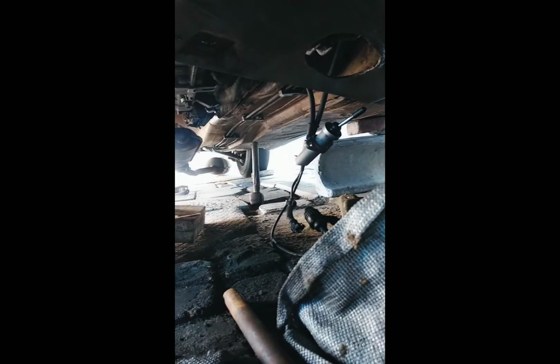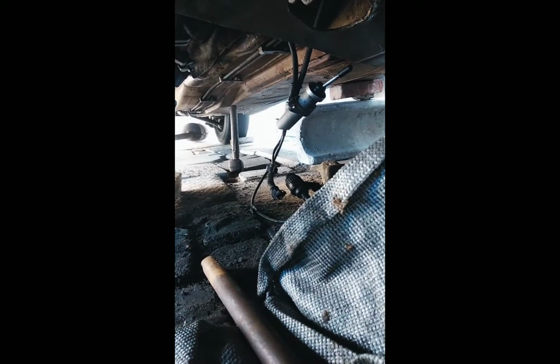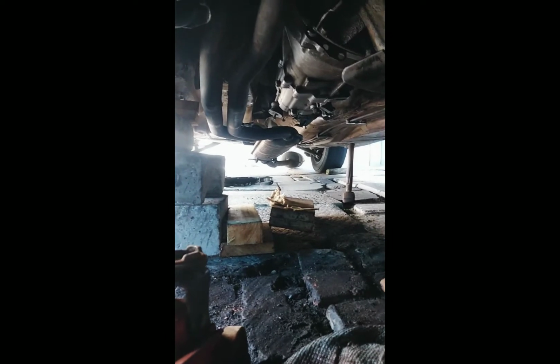So I'm just going to tighten up the box, tighten up the slave cylinder, bleed that, put on the reverse cable, and we see what happens from there. I never broke anything, so I won't say you'll break an arm or back doing this, but it is quite challenging. And look how nice and clean the gearbox looks compared to what it was before.